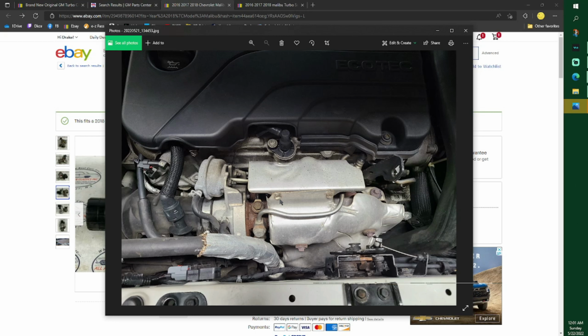This is 6 point here. Look, there's 12 point on this. There's 6 points, like a stop sign, kinda, I guess. I can't tell you what size these are, but they're supposed to be a 10 millimeter, and most likely they will not be a 10 millimeter when you take it off. I ended up putting stainless back in, but I put washers in between there so it doesn't corrode onto the aluminum, and that'll work good.